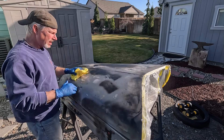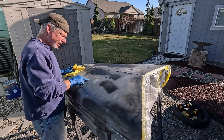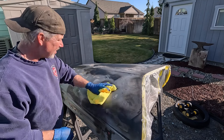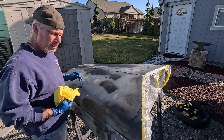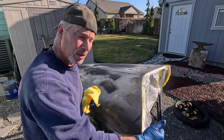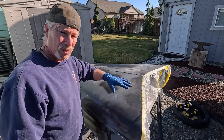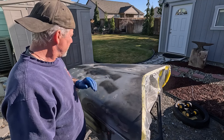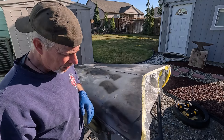Out here in sunlight I can see there's tons of scratches, which is fine - little pits. These are actually not scratches, they're marks in the paint but they're not deep. We're gonna go mix up some paint and blow this off right before we spray. I've got a little tape and plastic on here because the underside is already painted and I haven't clear coated it yet, so if I make a mess, no problem - I'll just hit it again with the color and give it a light sanding before clearing.